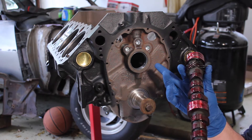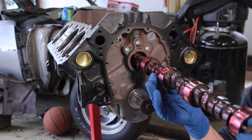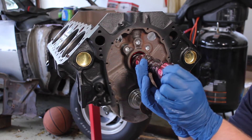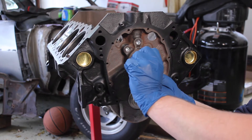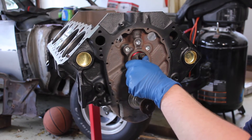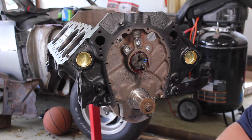Now that the camshaft is at the engine, it's time to put it in. The only things to be careful of are not pushing the bearings out as you install the camshaft and not scratching the bearings at all. You might have to twist it around to push it through some of the bearings, but generally it just slides right in, especially if you've got it lubed up enough. Now that's not done just yet — we still need to finish the rotation placement and install the timing gears, but that's for the next video.